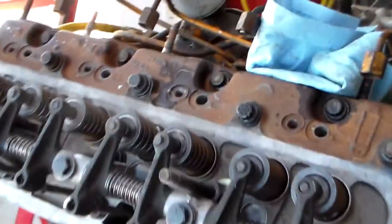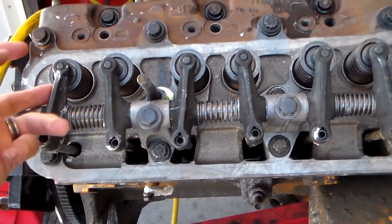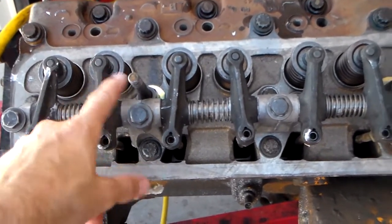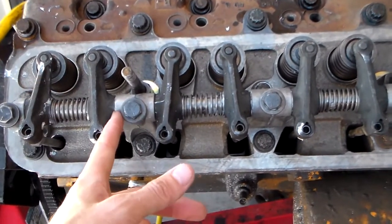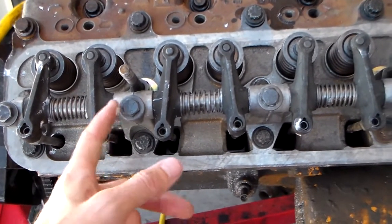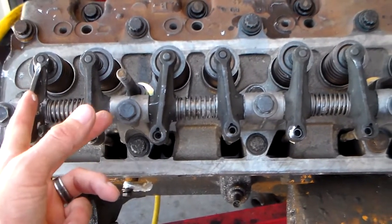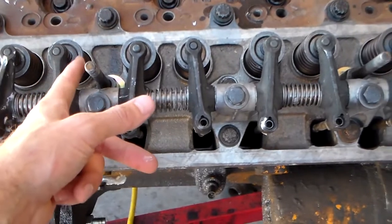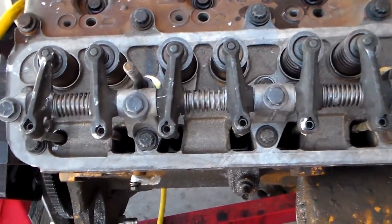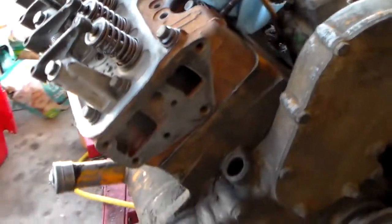The overhead is in. There's an L and an R on the underside of these — I should have showed that to you. If you put them backwards they won't line up against the rocker clamp. If you've got them switched around, one will be pointing the wrong way, so make sure you do that correctly. Next is injectors, and then I'll start on probably the water pump and work my way on from there.